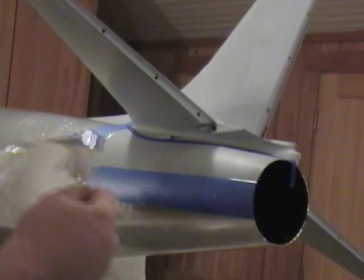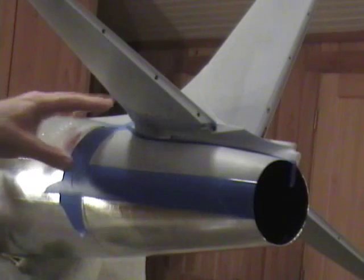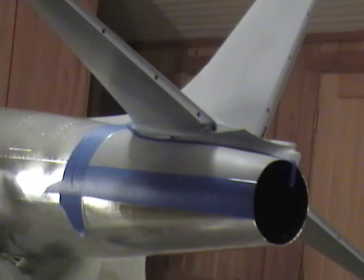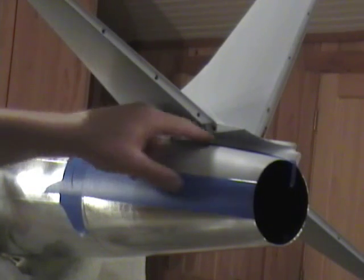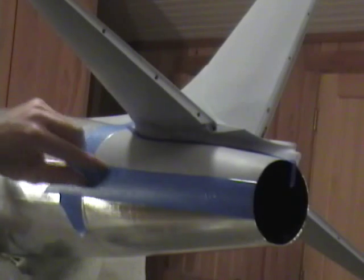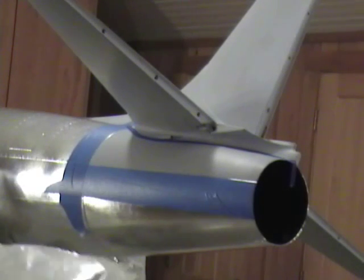What I went ahead and have done here is I've taped off the panel that I want to do, just to speed things up. I used 3M painter's tape up here because it's a tough curve. These are just regular tape because I have good thick panel lines. It's going to really help me cut this off.